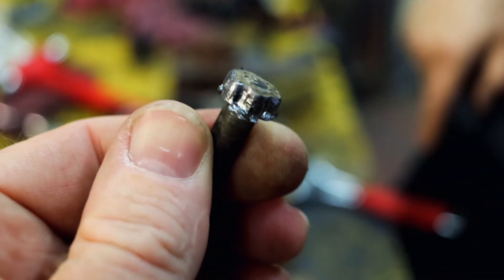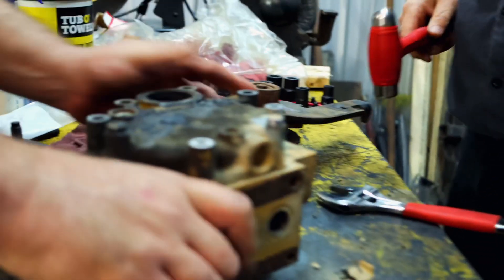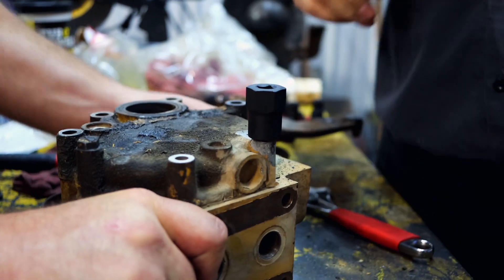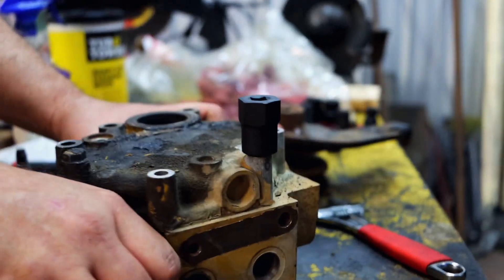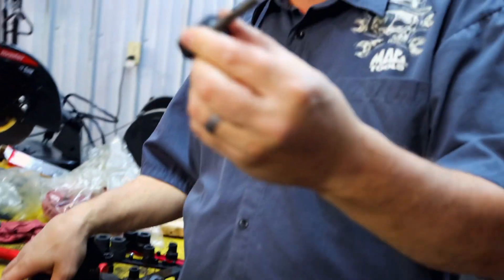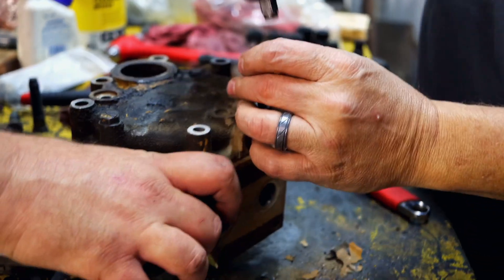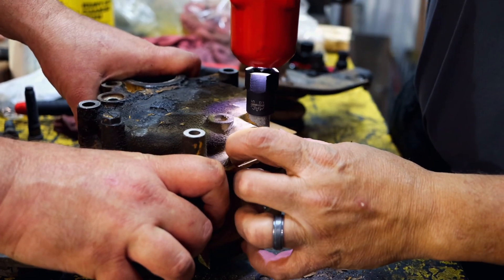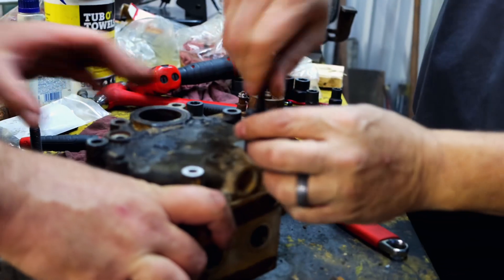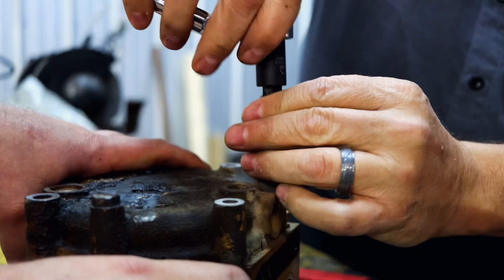Moving to the next bolt, going straight to the half-inch extractor. Dan asks to use the 3/8ths cordless impact — these are totally impact rated. Out they come. He then shows the retightening capability, putting the bolt back in and snugging it down. Then uses the pusher screw to pop the bolt right off the stud. You can let that vehicle go down the road because that's tight.